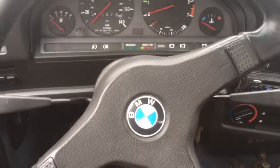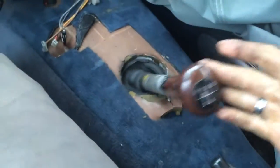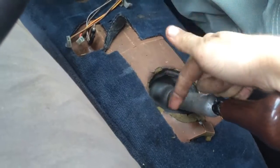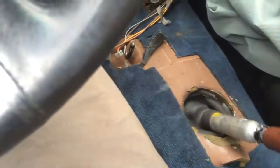This is the 85 323 Euro with the V8. This is the shifter with the E30 linkage in it — that's neutral, that's third. The E36 linkage is just a little bit longer, which will make neutral all the way up, third and then down there will be fourth. Right now, reverse, first, third and fifth only are accessible. Handbrake's good. Euro clock, it's got the German check panel.